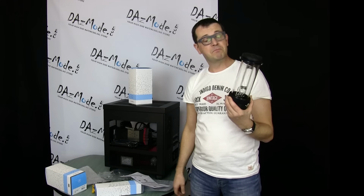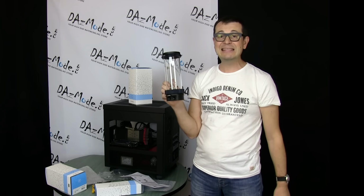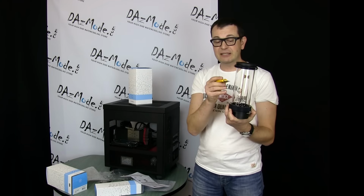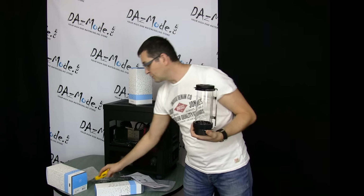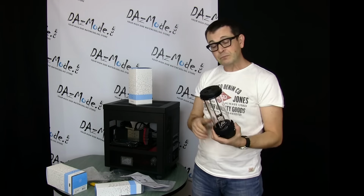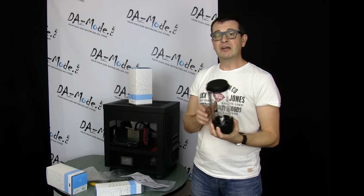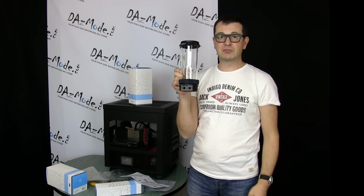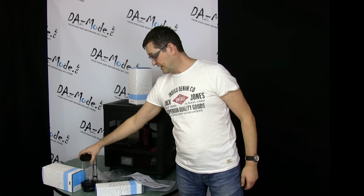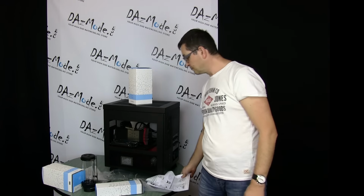and while it's the same 250 millimeters tall, you can see the diameter is humongous, it's 80 millimeters. Also, the thing is made out of glass instead of plastic. Doesn't sound like much, but believe me, this is glass and it's really heavy. This huge reservoir takes almost 1 liter of liquid, so if you're going to use it, prepare to double the amount of liquid in your system, and obviously double the cost for that as well. So if you're going to use something like Ice Dragon, it will cost you.